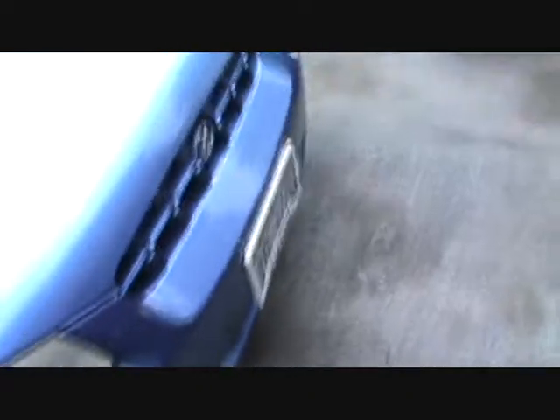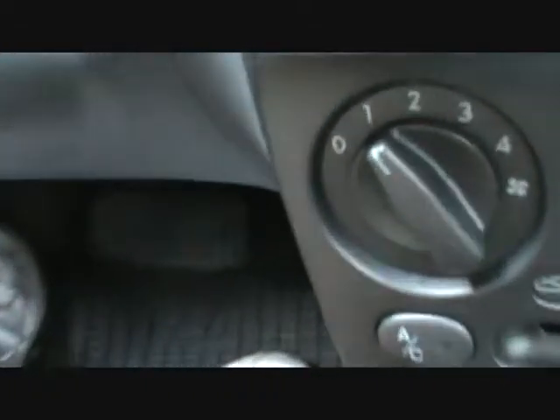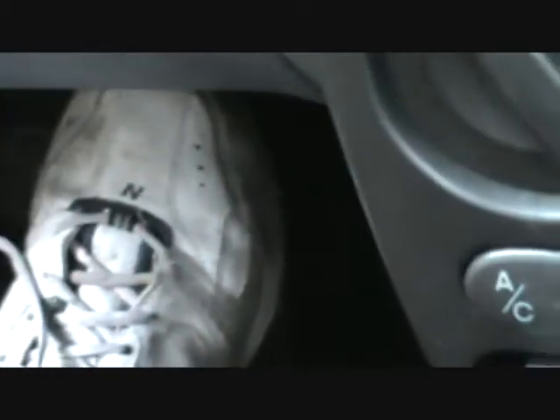Alright, the car is finished. It's lowered down. The oil has been checked. The most important thing to do when you change your brakes or work on your brakes — and I will be doing that right now — is make sure that you push the brake pedal and pump it up. Because if you don't do that, the first time you put it in reverse or drive and put the brakes on, you'll have no brakes. Because you pulled the piston back as far as it would go. Now we're going to be going on a test drive to make sure the brakes are alright.